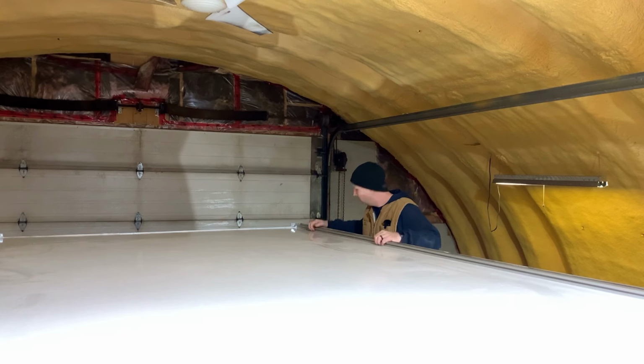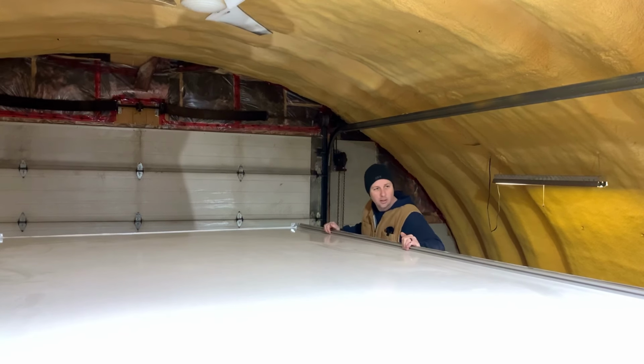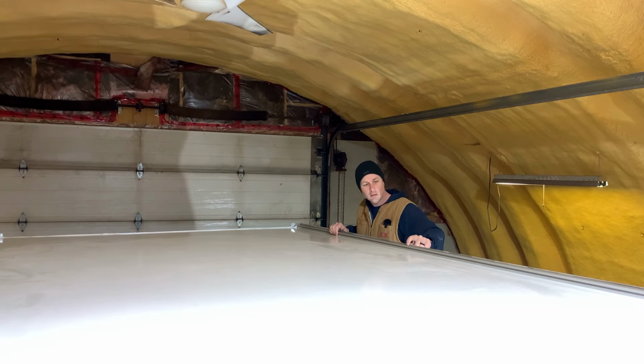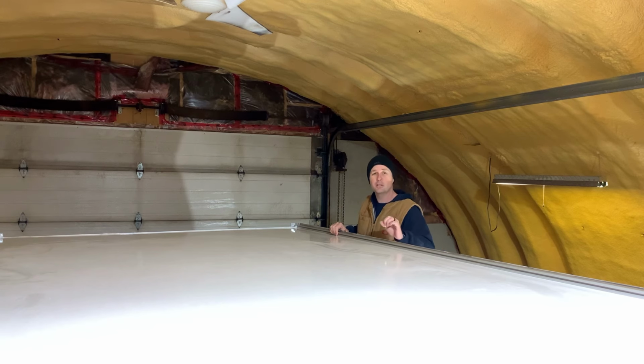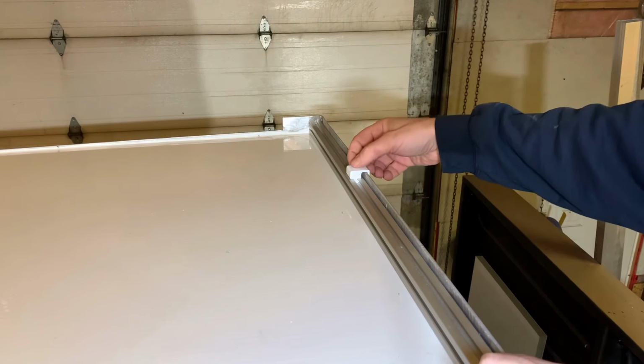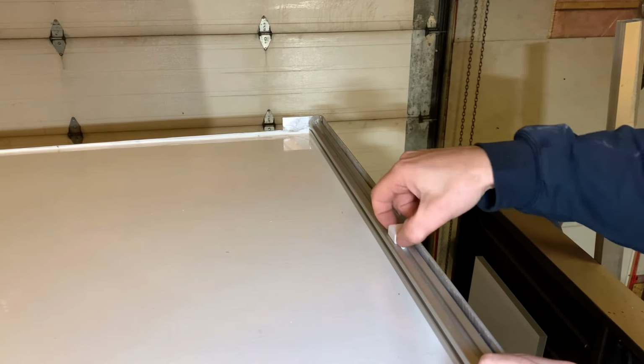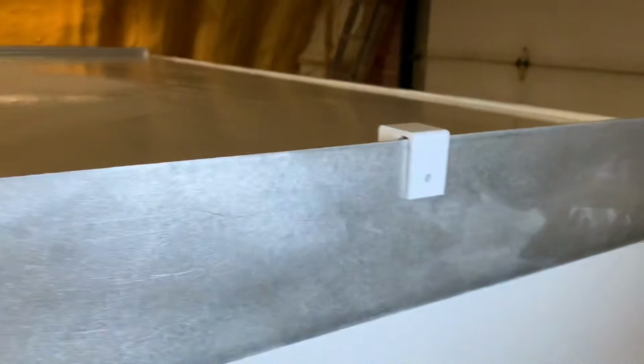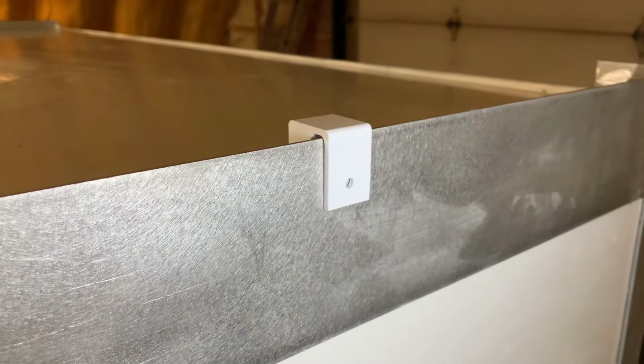and then slide that jig along here to all the places where I want the bolt, and then mark it. I've actually made that jig the size of a center punch, so I can just center punch, then I can remove the T-slot and drill through. And if you weren't quite able to picture what I was saying there, this slides along in the T-slot, and then on the outside, gives me a marker of where to drill the hole.